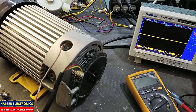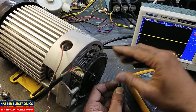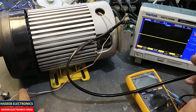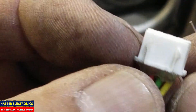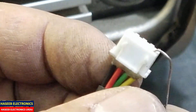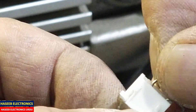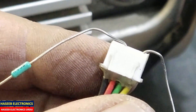How we can test it — it has a separate connector here. I will use 5 volt to apply power to this transducer so that we can test it independently without its motherboard, because most of the time these transducers fail to give feedback. The rightmost pin is 5 volt — that is the yellow wire. Pin number 3 from the right is the ground wire — that is the red wire. Note that here the red wire is ground, not positive. Pin number 2 from the right is the output pin.